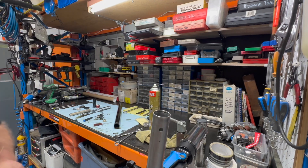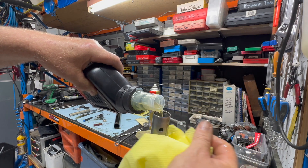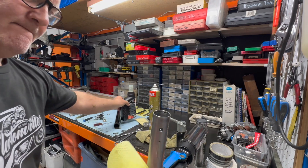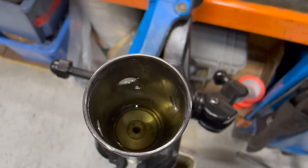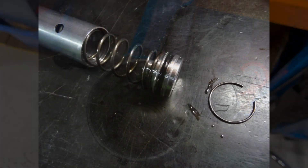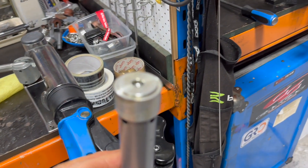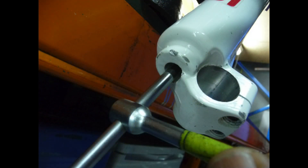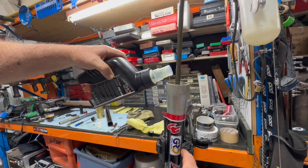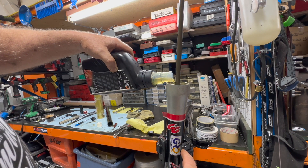Once that's done, add a little bit more oil. Get that cap in — I'll show you how it sits. Remove that little screw, slide it in nicely — see, that's deep in the oil — then put the screw back in. Once the screw's back in, put the spring back in, put your circlip back on the bush, the end cap, and then back into the leg. While it's like this don't push the rod down — we want it at full extension. Get it all nipped up into your lower fork leg.